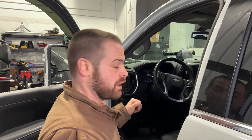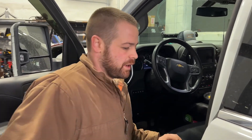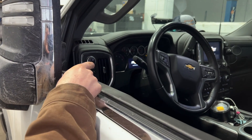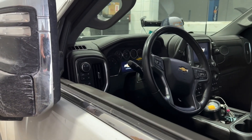This is a 2022 Duramax L5P Stealth Module install. The first step is to pop the hood and wait for the truck to go to sleep. Don't disturb the truck while installing it. Once those dash lights shut off, wait a few more seconds and then the truck will be asleep.